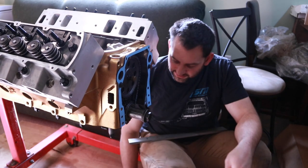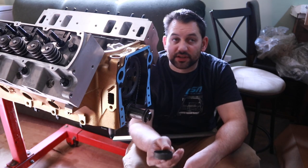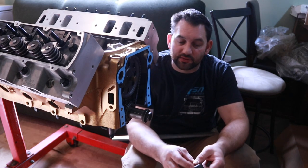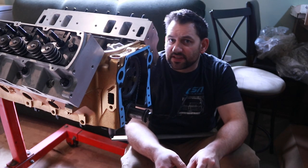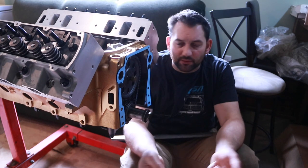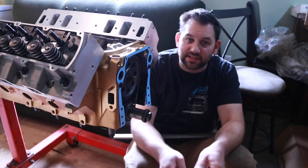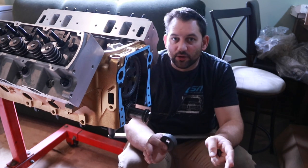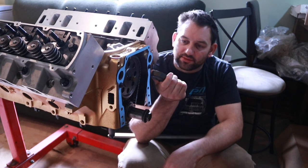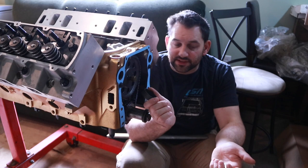You could go about this by running the stock fuel pump eccentric and then getting perhaps what they call a machine shim, which is just various thickness washers that can usually be had in 5 or 10 thousandths increments. Then you'd be able to set the thrust forward and rearward. You probably want to shoot for something between 6 and 15 thousandths. It allows a little bit of room for expansion and it's not holding all the parts tight against each other. That could be accomplished, like if I ran the fuel pump eccentric plus a 30 thousandths machine washer, I'd have 7 thousandths of thrust clearance.